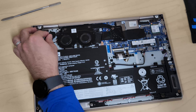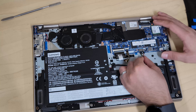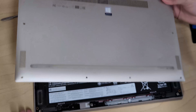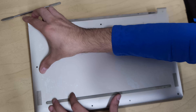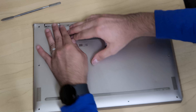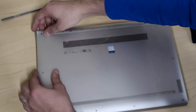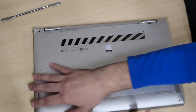Place the small battery back in position using a little dab of glue if it's not sticking anymore. Then reconnect the main battery connector — push it in all the way. To put the case back on, start with the bottom, align it, then push along the sides — you'll hear it click into place. Click along the top as well, and press the center of the bottom if needed. Remember: the longer screws go on top, and the shorter screws go everywhere else.